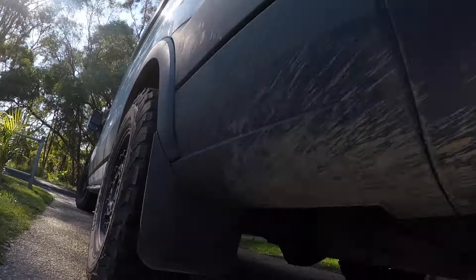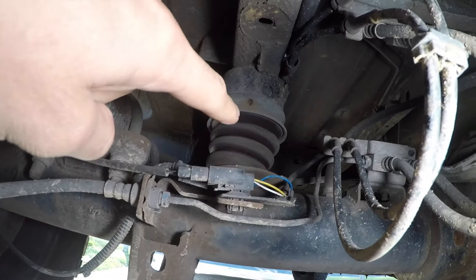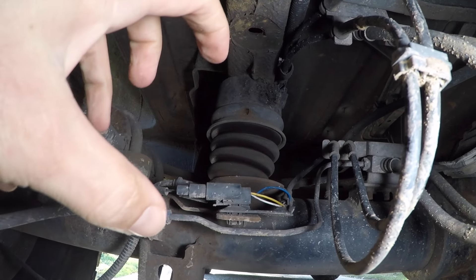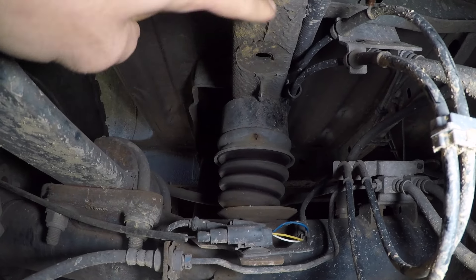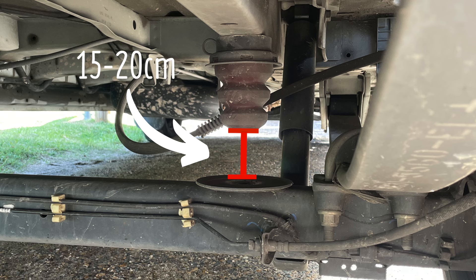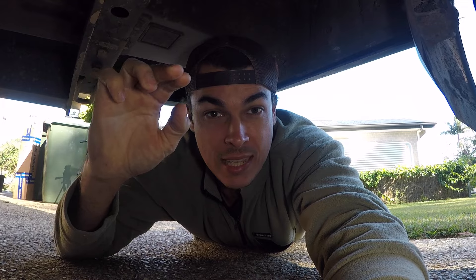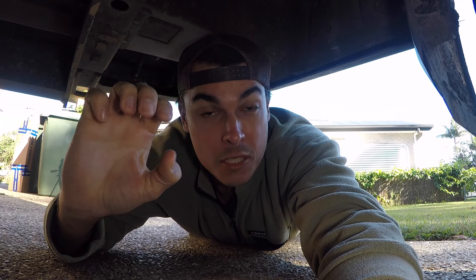If we come under the van — this is your parabolic spring, and this little black thing up here is your bump stop. In vans like this, they have a bump stop that is quite compressible, like a big marshmallow, but it should not be touching our drive shaft down here. The bump stop in this van is connected to the chassis and there should be a quite a big gap. When we first got the van, there was a gap of about 15 to 20 centimeters. As you can see, that is completely gone — that is how much our conversion weight has compressed the rear spring. On the driver's side, where most of the weight is, it is actually slightly worse.